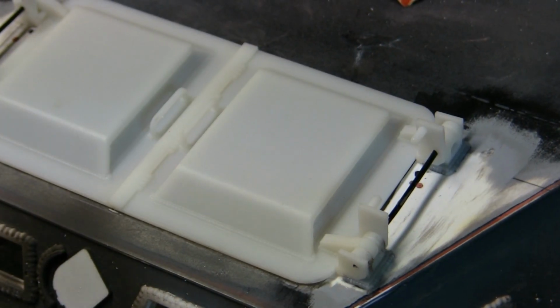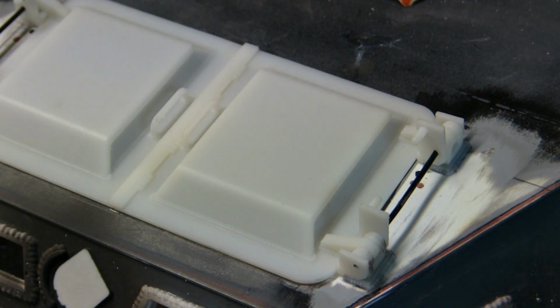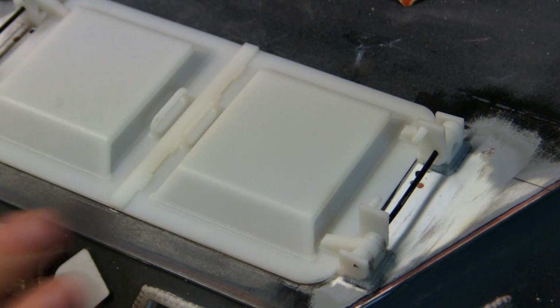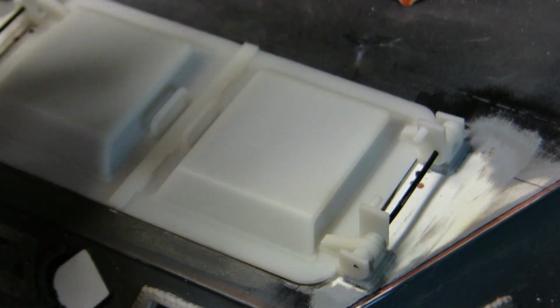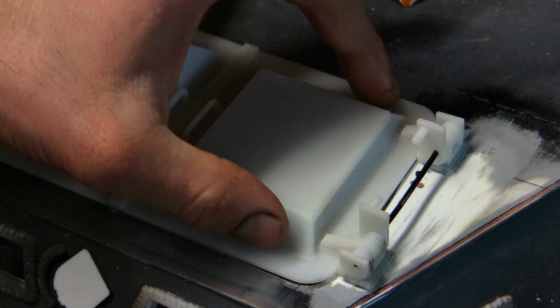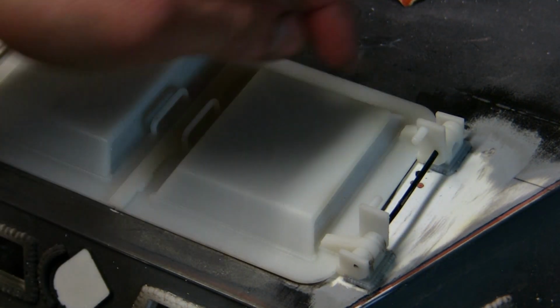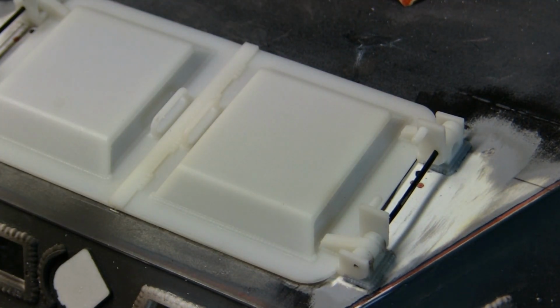So as I mentioned before, the hatches are a second generation hatch, and in addition to the headroom, something else that was requested by the troops in the field upon receiving these vehicles was a way to add a counterbalance spring to assist with the opening and closing of these hatches. Now, this is something that was thought up really more or less as an afterthought, and the solution was one that was very, very clever. It does not change at all the hinges that are designed for the system here, and it's basically something that can be a retrofit item and can be installed with relative ease.